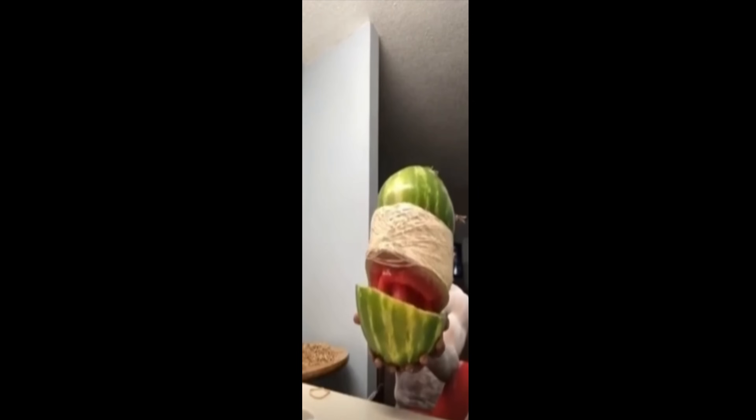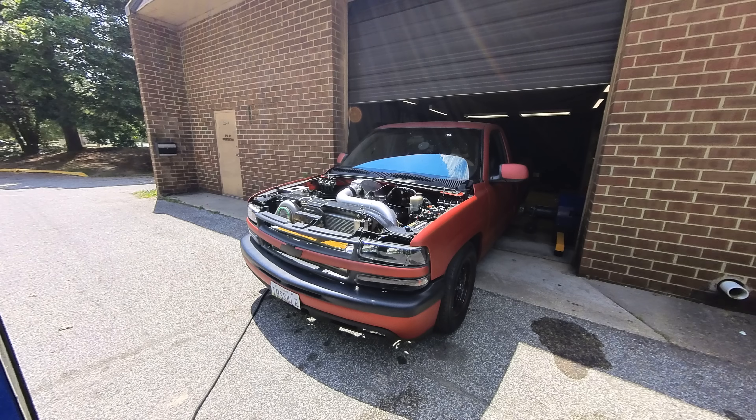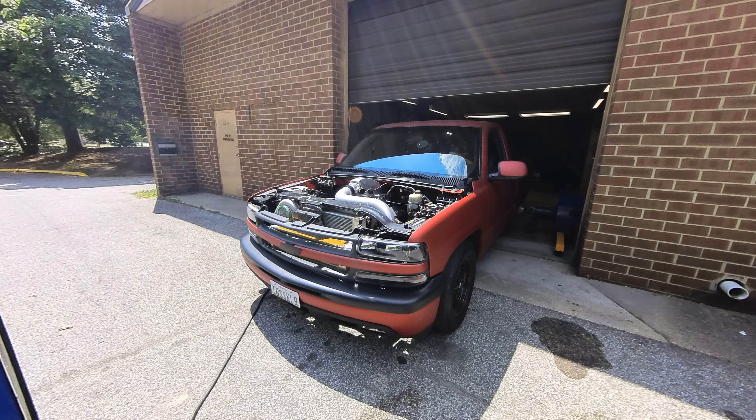Ethanol is reading 82% — looks solid, not going crazy, offset table working, fueling is good. This is two degrees of timing, boost control untouched. But the ethanol adder is not going to be linear — what I put in was real good for cruising but a huge piece of crap at full throttle. I'm going to turn my 1D table into a 2D table and try it again.